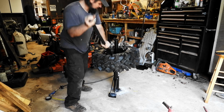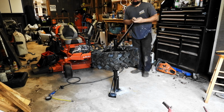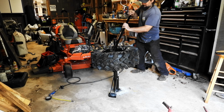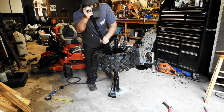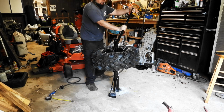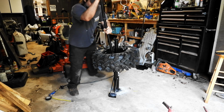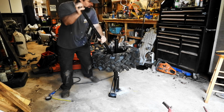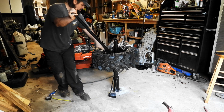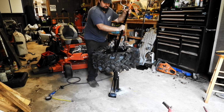Do a little bit at a time and try not to grab too much of the tire and fight yourself. So, tire number three was before this, and I got it in about 10 minutes. And that little final push helps get this bead under.